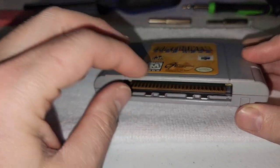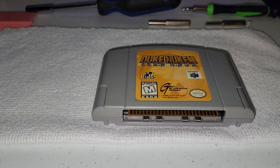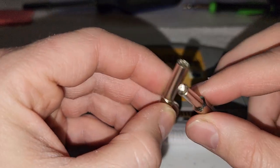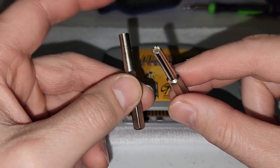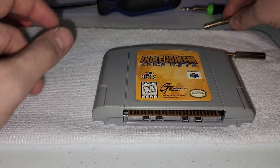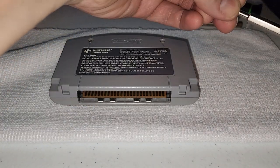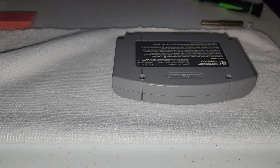So I want to take this apart and show you how to clean it. What you'll need is these security bits — you can buy these in a two-pack. I recommend getting the silver ones because they're better quality than the black ones and don't wear down as fast. One is smaller, one is larger — the larger one is about 4.5 millimeters and the smaller is around 3.5 or 3.8. You're going to need the smaller of the two. You also need a Phillips screwdriver, and optionally another screwdriver to hold the security bit.